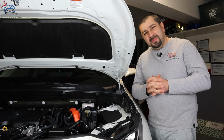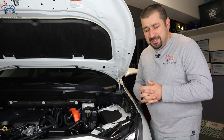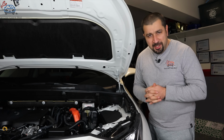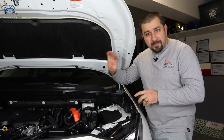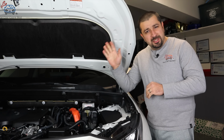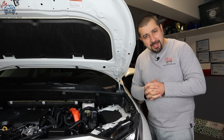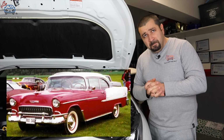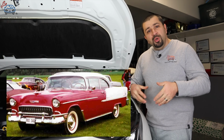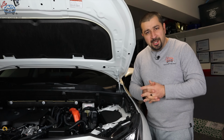Number 5. Are you still watching there? Don't jump start another car from your hybrid. Now, the reason for that is hybrids don't exactly have an alternator. They have a very fancy DC to DC converter that takes that very high voltage from the high voltage battery and steps it down to 12 volt, 14 volts to charge your small little battery, the 12 volt battery. Well, that is not exactly designed to, say, jumpstart a 55 Chevy. So don't go being the good Samaritan with your hybrid and offering to use jumper cables to jumpstart another car.